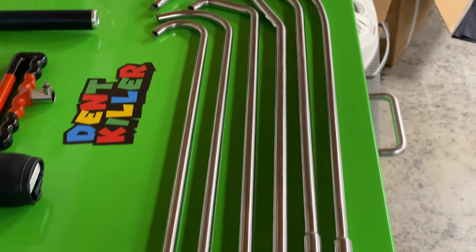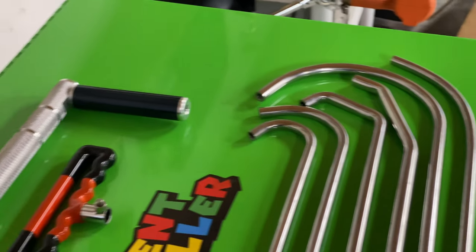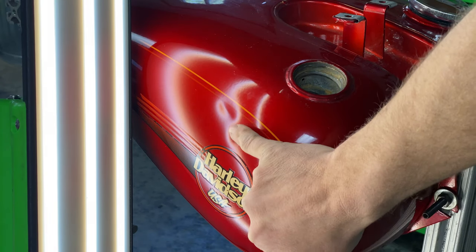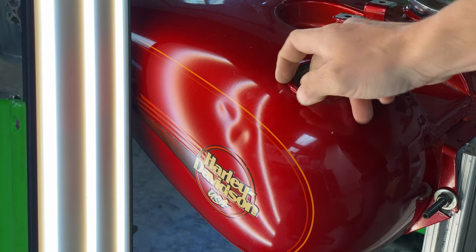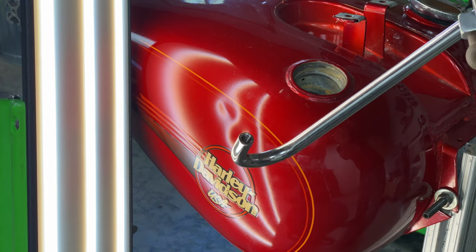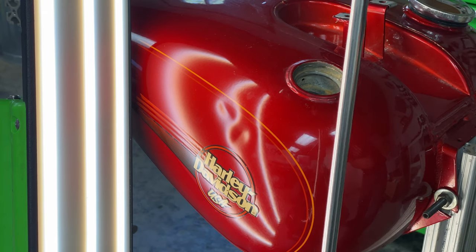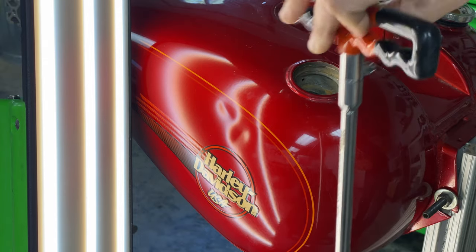I'm showing you some of the tools here that we use. There's about six primary tools that we use with different handles and we're going to go into a little more detail in a few minutes. Our camera is set up so that you can have a really good view of these two dents that we're going to be fixing right here through the fuel opening. We have a lot of different types of rods that we can use — I'll show you one that we're going to use on this repair. You can see it has a threaded end on it, it's a 5/16 thread, and a fairly long tool with a nice comfortable grip on the end.